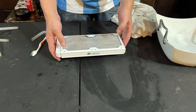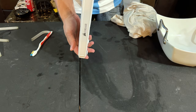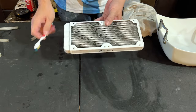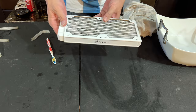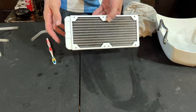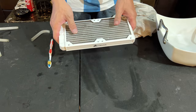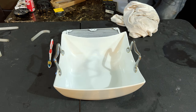It's been in here for about 12 to 13 minutes. Do this every once in a while - you'll hear the water actually move through the core, you'll feel the gurgle. You'll still see some discoloration on the fins. Just get some distilled water, get your brush, and very lightly scrub. Use air first to get as much as you can without scrubbing. Those fins are very fragile, so don't scrub hard.